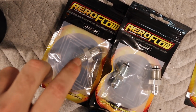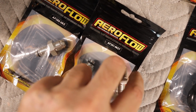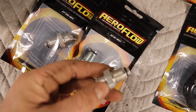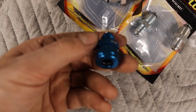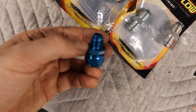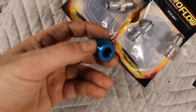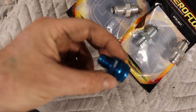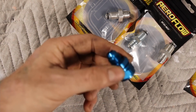And then on the Astra pump, that is the same as this part number here. So you need another one of this one here to go into the pressure side of the Astra pump. And then this is a 3/8 barb adapter to -6AN. So there's an O-ring in there, that unscrews, goes over the barb, and then that compresses onto the barb and then turns it into -6.